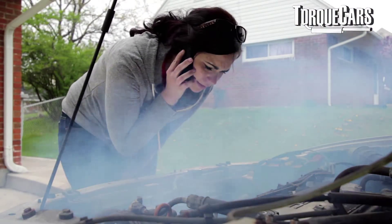One of the big telltale signs of a head gasket problem is if you look at the expansion bottle, or remove the cap on the radiator — be very careful, don't do it when it's hot. What you're looking for is bubbling within those areas. Bubbling would indicate high pressure going from the compression in the engine into the coolant system, and that will typically identify a head gasket problem straight away.